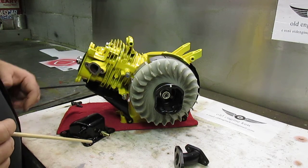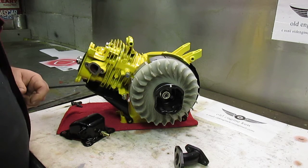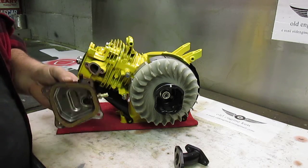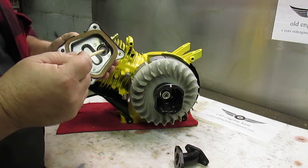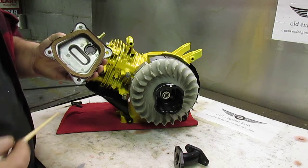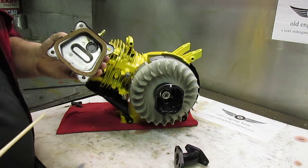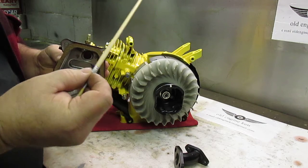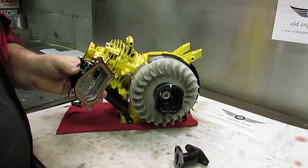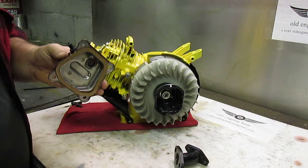A couple of issues that have been asked: why do I get oil in the line going to my fuel pump? Usually that happens when somebody has tampered with this little check valve or taken it out completely — I leave them in. I've had a couple go-karts with oil issues in the pulse line, and what we normally find is that the filter for the blow-by tube is kinked off or the filter is plugged.